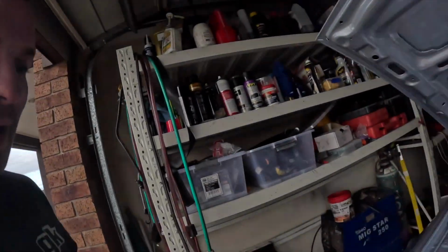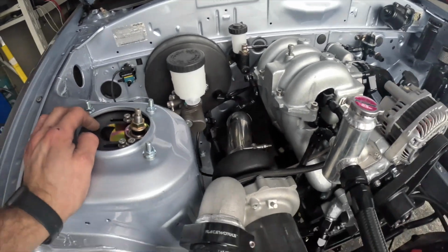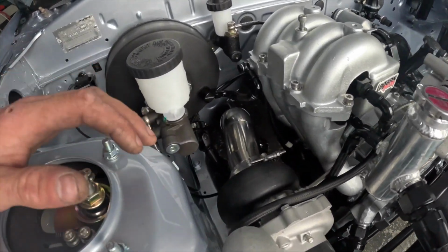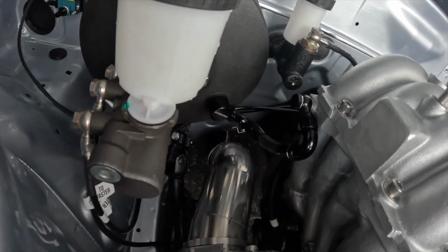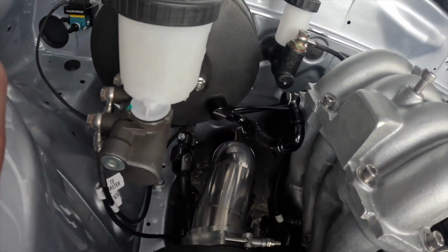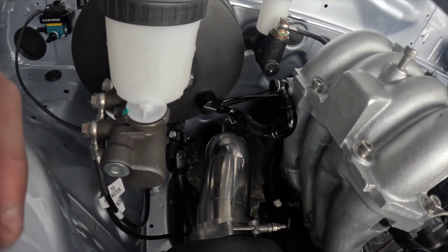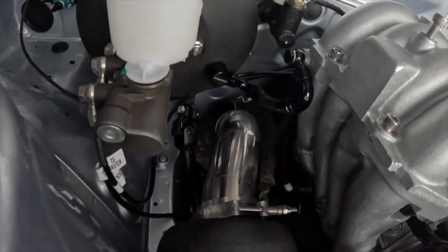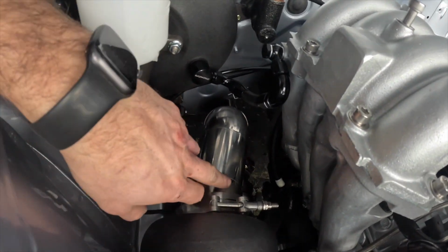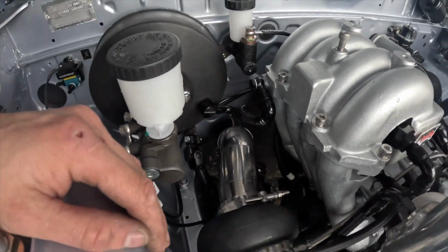Unfortunately, it took a little bit longer than I expected. I'm out of time, but great news is we've got a downpipe. She's all tacked up. A little bit ugly in spots, as the exhaust I was working with is actually not a true 3-inch, it's a little bit bigger. So you can see a little bit of an overflow there. But yeah, it lines up. All that will get heat wrapped anyway. And it sits really nice. Little pie cut up here just to take the angle away, and it's all it needed.